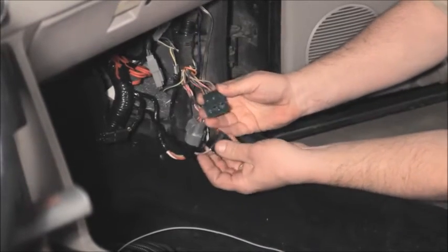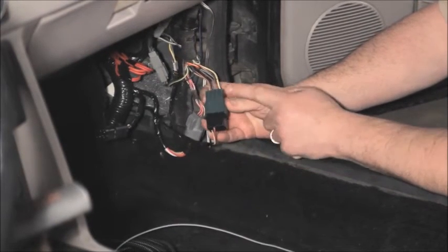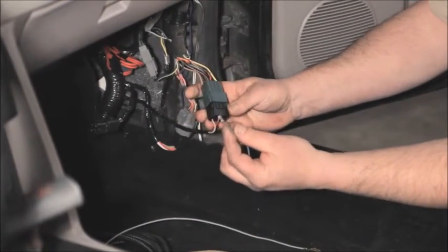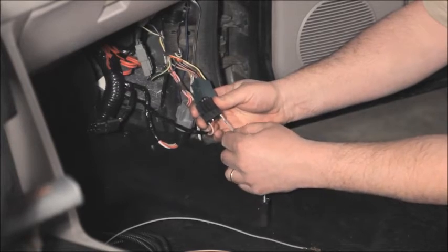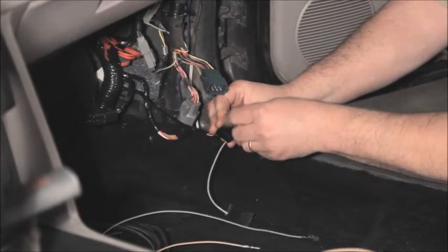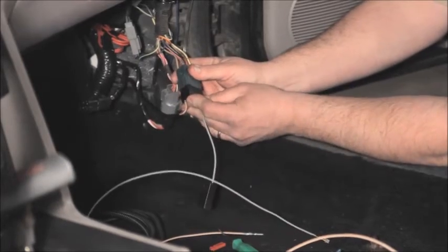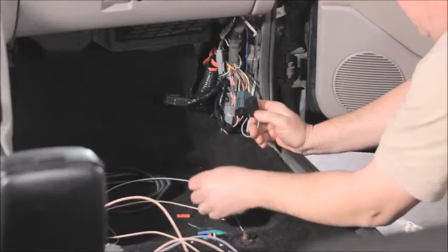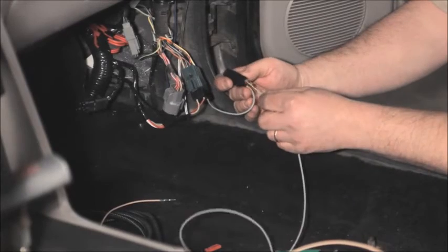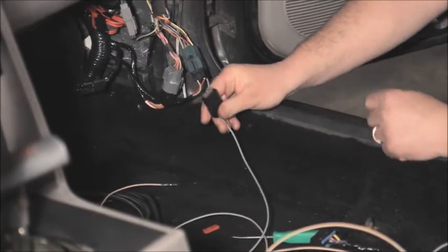And you will see that when you put the connector in place, there is no wire to correspond to this gray one in the dash connector. So you take this wire here, same thing, you just click it up into place. Put the retainer back in. Plug these two halves back together. So again, this wire here is installed up in here. This wire here, you will take and click up into place in this little fuse holder. Take the fuse and plug it in. There you go. Check engine light's all wired up.